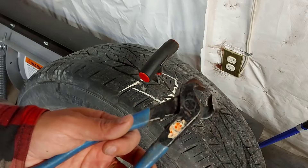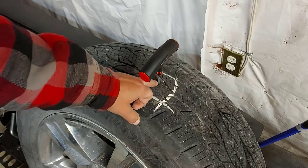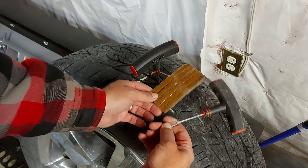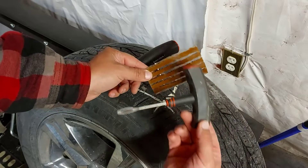I just used a pair of pliers like this to get the screw out. If you don't have a head on it that you can grip and pry the screw out, you can push it through with this tool here. You can get a tire plug kit just about anywhere. This is what it looks like — you get one of these tools, one of these tools here, and you have these plugs.